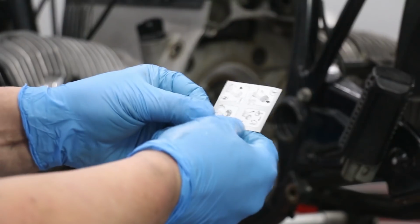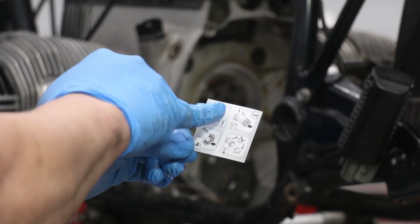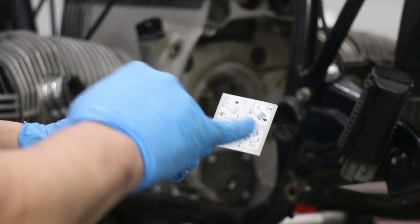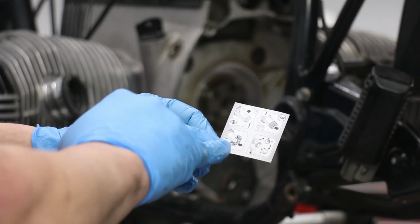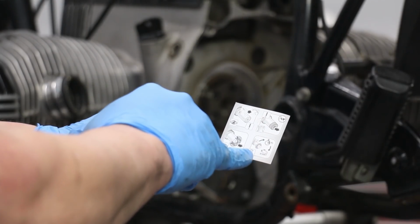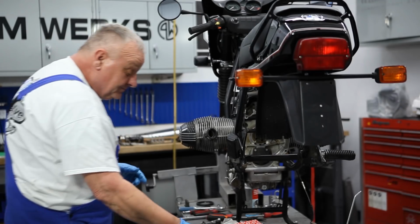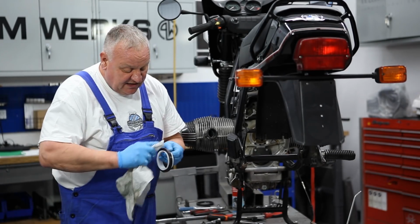But on the other side, more importantly, it says really clean it, no junk on there, absolutely clean. And then it says here, no oil, dry, with an exclamation point. Wipe it with a rag, clean. That's what they're saying. And then this is the way it's installed that shows that. And then it says that you should wait 4 hours before you start the motor after installing the seal. So they probably know what they're talking about, so I'm going to go with that. Okay, so clean means clean.